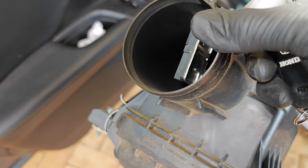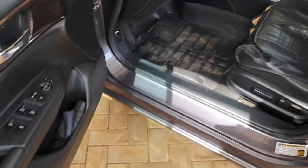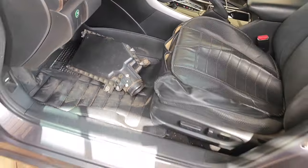Since the MAF sensor is now exposed in this air box assembly, I'll just put it into the car so that dust doesn't settle on it. Next we'll start getting to the bolts that are under the battery tray connecting it to the lower portion of the air intake duct. It's this 10 millimeter bolt — you loosen that and take the bolt out.